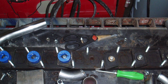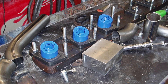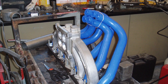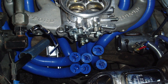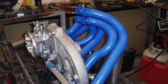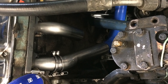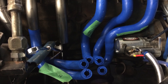Some of the blue plastic pieces you're seeing are actually from Ice Engine Works, which allows you to build a kit basically like stacking Legos together. They have three different radii and a few straight pieces, and this allowed us to mock up several different iterations of how the pipes are going to go. We were trying to achieve equal length headers if we could, despite getting around the starter, air conditioning, and power steering, and to try to get all six cylinders to merge together. We bought a pre-built six-into-one merge collector.